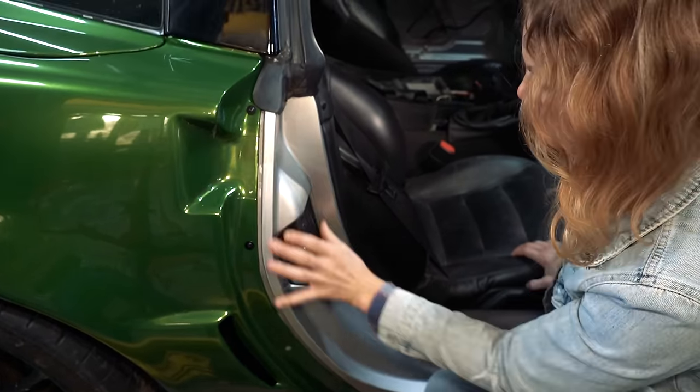Alright, so what happens is, put the Allen wrench in there, and it's going to be at this angle. The clip's going to be against the steering wheel pad or horn button, whatever you want to call it. I was going straight down and I was missing it. So if you just twist it a little bit, you'll start to feel it in there, and then you'll feel some spring action. And it comes off.